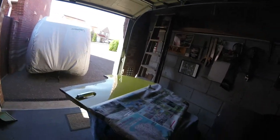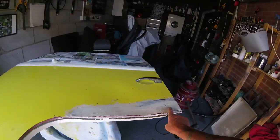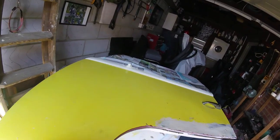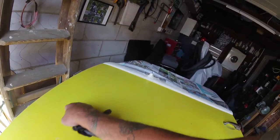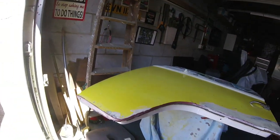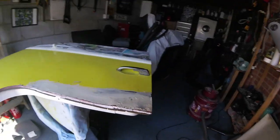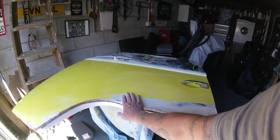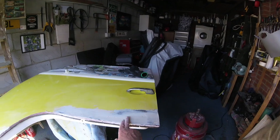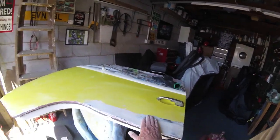I've flipped the door back over. I've also masked up the glass and the white part around the top with some old newspapers. Now I'm going to have to start this sanding and smoothing off, and obviously I'm going to have to sand the whole door a little bit so that we can paint it. Next job is flattening out where this filler is - I'll just give it a first sand over to bring down these high spots. I need to smooth it out the best I can.